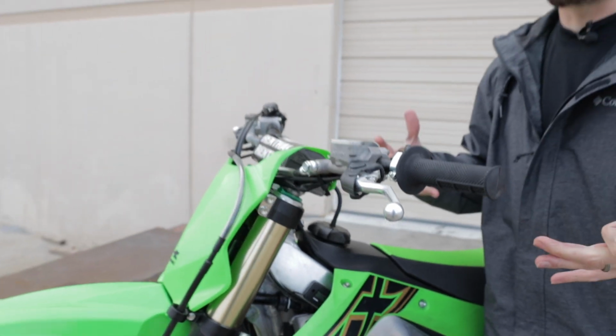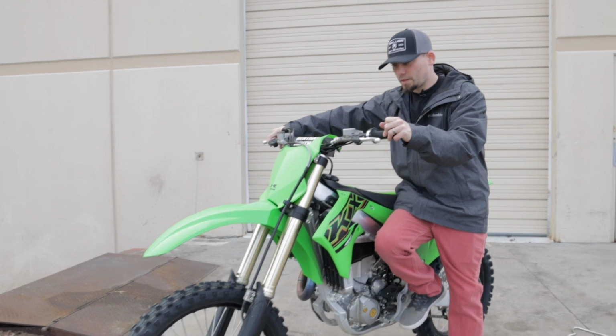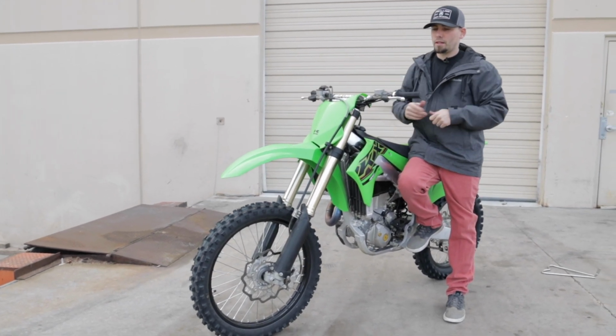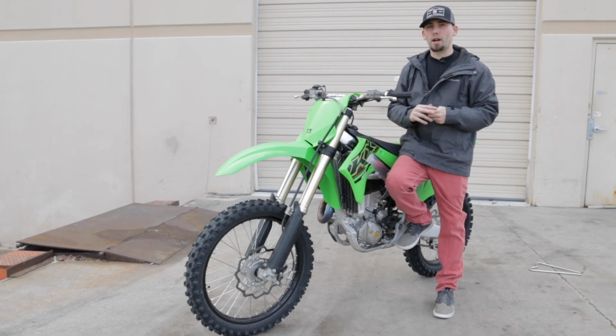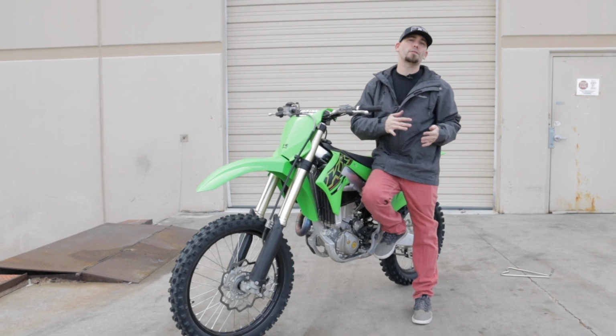So that's better. That's still maybe just a tad bit too much, but it clicks into gear and it sits there. As much free play gain as you can run without it trying to drag forward or stall on you is good. It's the safe side of the spectrum to be on.